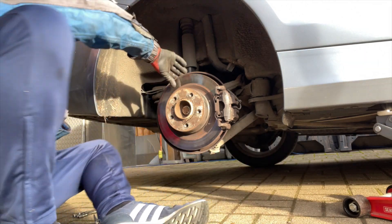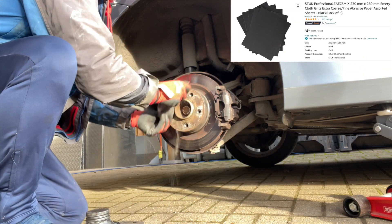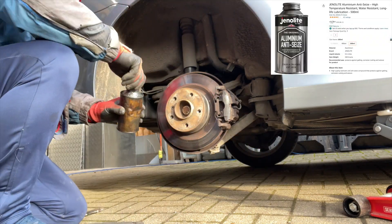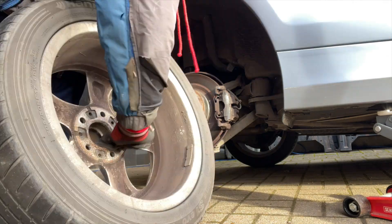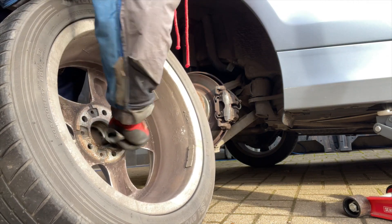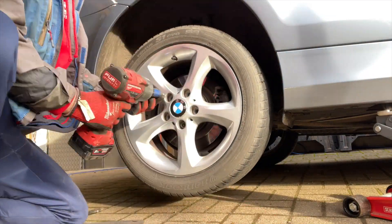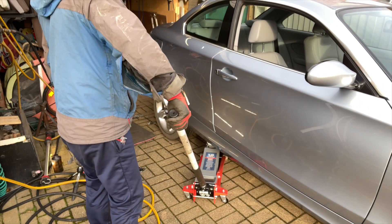Let's get a little clean up - a quick rub with the emery cloth to get rid of that corrosion from where the aluminium meets the steel hub. A bit of the aluminium anti-seize grease - clean that alloy up, clean that spigot up there - and then whack it back on again. Put the handbrake back on and then drop the jack.